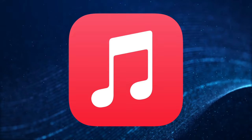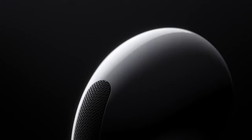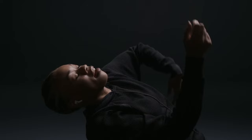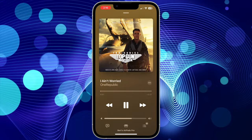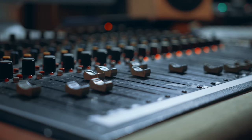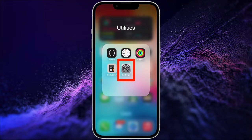If you're an Apple Music user, you can also check the custom audio settings for Apple Music, as they can also cause your AirPods not to be as loud as you may like. There are two primary settings in Apple Music that may cause this: Sound Check and the Equalizer. The Sound Check feature basically tries to keep your volume consistent across all songs. Tweaking the EQ setting can also be why your AirPods sound quieter — lowering the EQ sliders for a certain frequency range means suppressing sounds in that frequency, which leads to an overall lower volume.